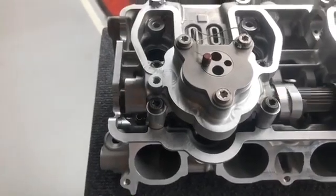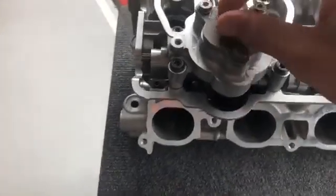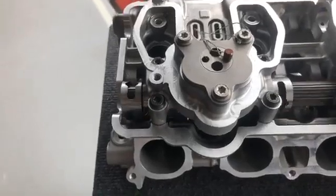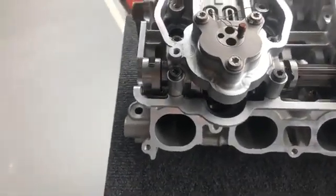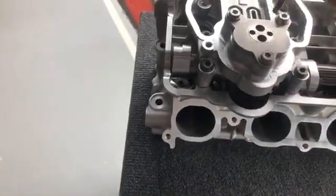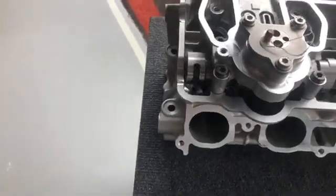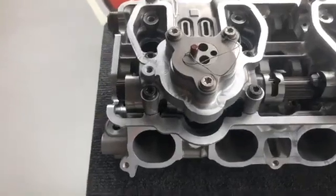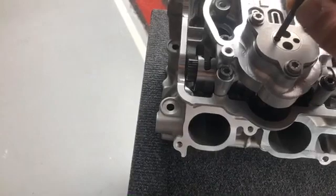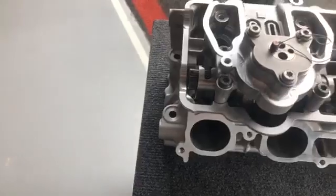Which is quite unbelievable. It's such a simple idea and yet extremely clever at the same time. I don't know why it's not been used before. This actually happens — this pin gets dropped in three milliseconds. That's the time it has. So the cam's spinning that fast, it's got three milliseconds to be able to move the camshaft over. And if it finds that it's actually taking a little bit longer than three milliseconds, it will pull it back out of the way and wait for the next cam revolution to move across.